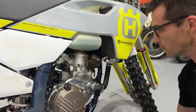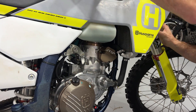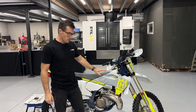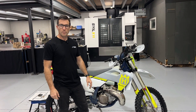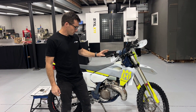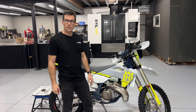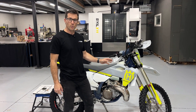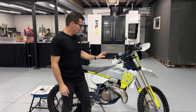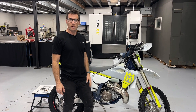Now we can replace the radiator bolts and put the pipe back on and we're ready to go. So that's the job done. Total installation time is less than five minutes or so. The bike is now ready to ride and ready to experience the new extra bottom end and mid range torque that you'll have at low throttle, 3000 to 5000 RPM. Ideal for hard enduro or trail riders. Thanks for watching.